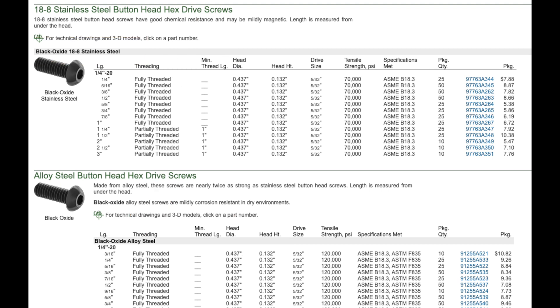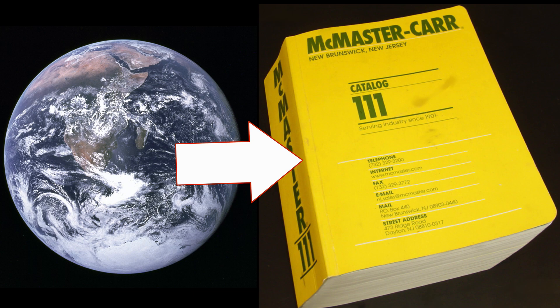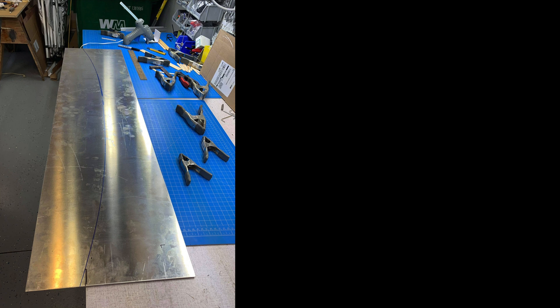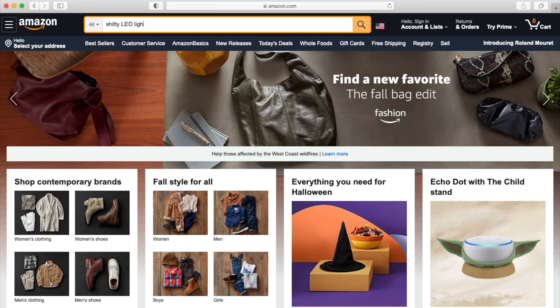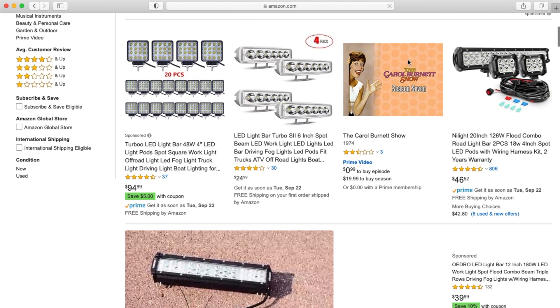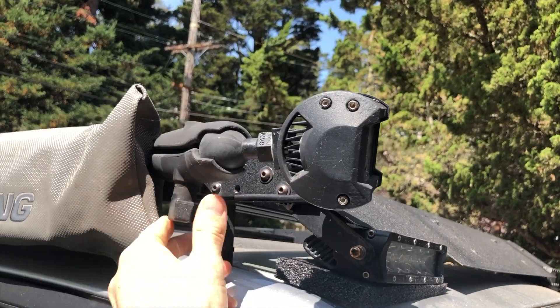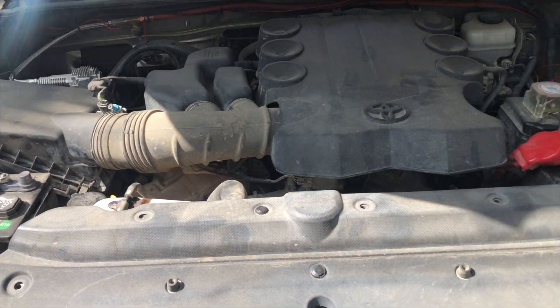The quarter-inch bolts were all one inch long. The only special parts I used were these angles made for the aluminum extrusion — you can get them from T-Nuts or McMaster. By the way, you can get literally everything from McMaster.com. The aero shield was, I think, 0.063 aluminum, 48 inches wide — you'll need about a foot long if you're cutting out the curve at the front; mine was only six inches since I just did a rectangle. You can also use plastic for the shield, but make sure it's UV stable, as many plastics become super brittle in the sun. My lights were from Amazon — just search for cheap LED roof lights. I also added lights to the side, which have come in really handy for camping. If you do that, don't leave them on unless you have a separate battery.